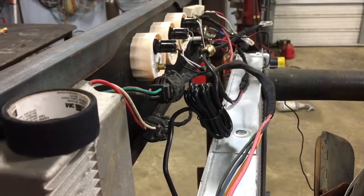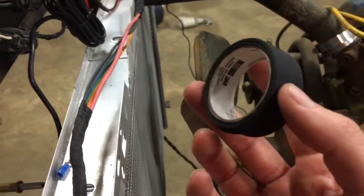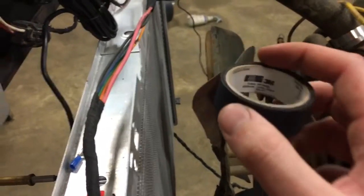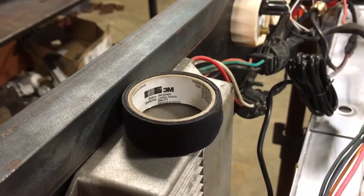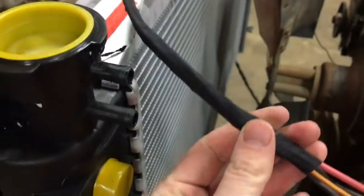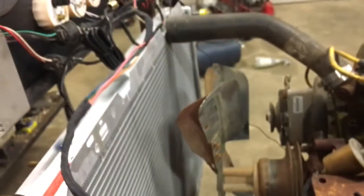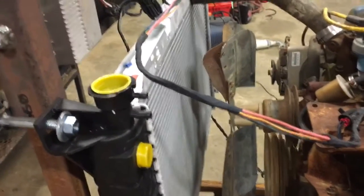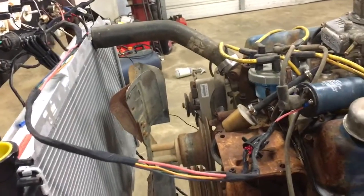Those gauges are cheap. I need to include a video of this thing running sometime, and I may put a more detailed video on how I built this up soon. This is called friction tape — you can buy it at Walmart pretty inexpensively. I've got bigger rolls too. Friction tape is better than vinyl tape in an application like this because the adhesive doesn't melt and become gooey like regular vinyl electrical tape, so I wrap my wiring harnesses with friction tape instead.